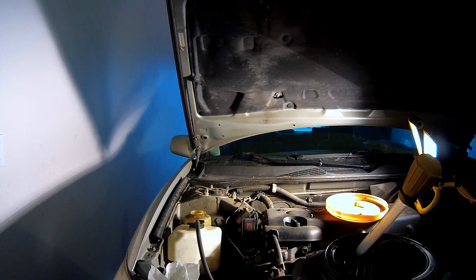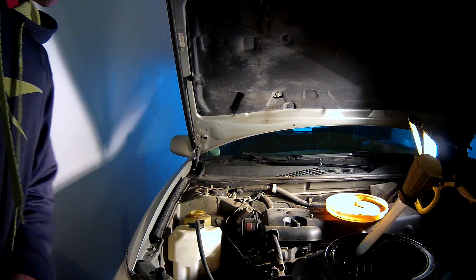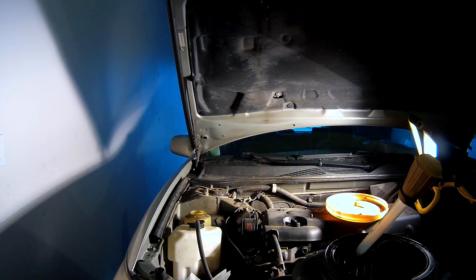I'm finished. This is very important — I ended up jacking up the car just a little bit so I can turn the wheels freely. There's no fluid in here, so do not start your car. It will ruin your power steering pump. I'm just putting the key in so I can turn it and let the fluid flow a little bit. I do have the emergency brake on.